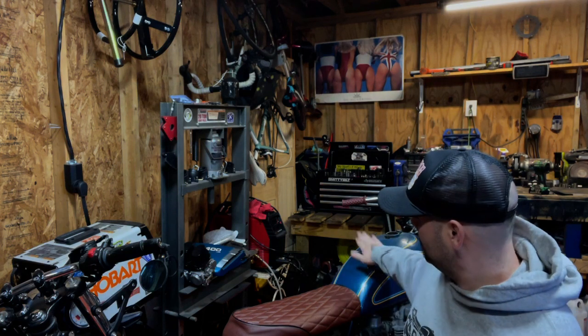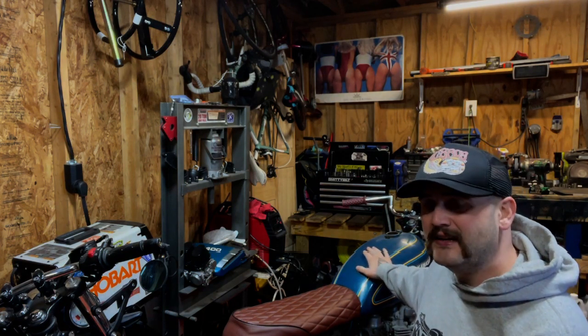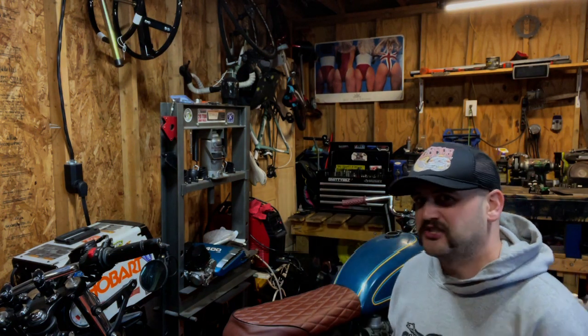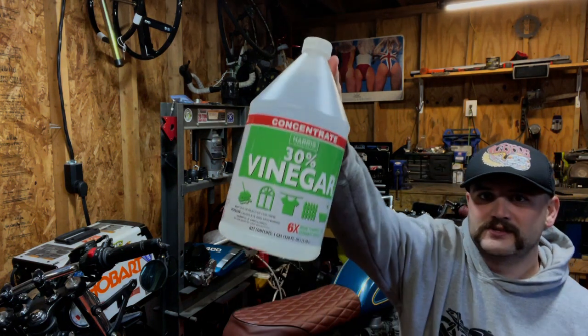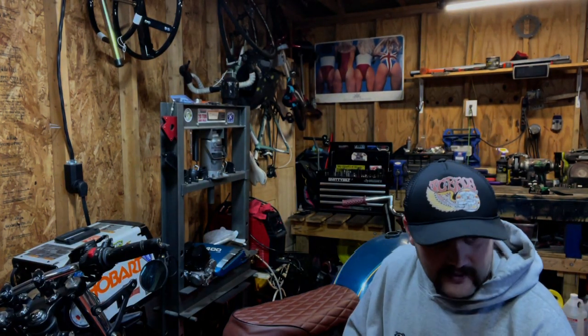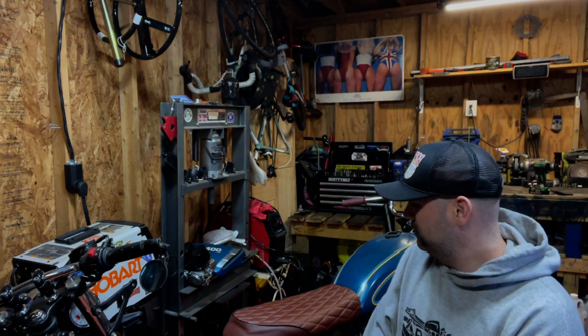This tank is pretty rusty — it's got a little bit of rust flake in it. So the first thing we're going to do is put the chain in it and shake it around to break all that rust loose. Then we're going to fill it up with this 30% vinegar, which is much stronger than what you get at a normal household grocery store — it comes from a hardware store. It will hopefully dissolve all the rust off that tank. It takes about 24 hours, the same as electrolysis. Once it's all dissolved, we'll dump it out and hopefully have a clean tank.